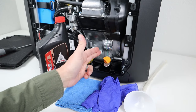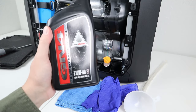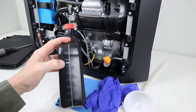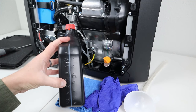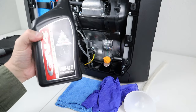The next step is adding oil to the engine. This calls for four-cycle 10W-40 engine oil — the same as used in a Honda four-wheeler. I mark where the current oil level is and we're going to add 380 milliliters or 0.38 liters. You can use basically any engine oil as long as it's 10W-40.